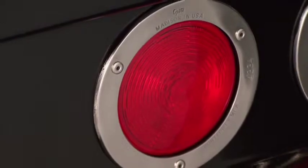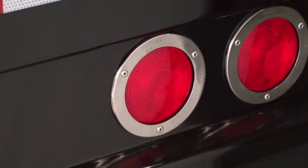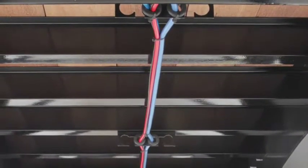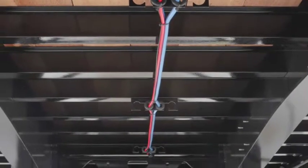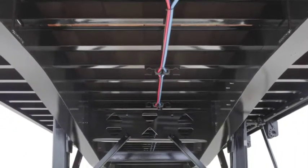The Velocity trailer comes standard with a fully sealed modular wiring harness and LED lights featuring a five-year warranty. The air lines and electrical harness are left unpainted for easy identification and maintenance, and are installed down the center of the trailer for easy access. Each is run individually rather than bunched together, and they are easily removed and protected by rubber grommets.